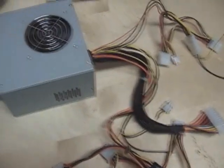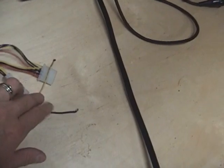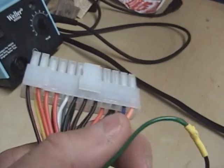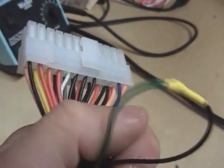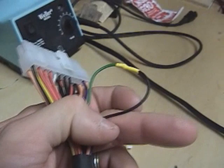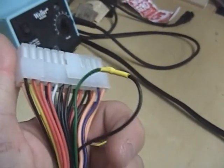Here's a power supply I've already modified. I made sure the switch was off before I started. With the clip facing you, I pulled out the third wire (black) and the fourth wire (green) — just pulled them out with my hands; it takes a couple pounds of pressure. Once they're out, cut the ends a little, tie them together, solder them, and put heat shrink on. A tip: remember to slide the heat shrink onto the wire before you solder, because you can't get it on after.